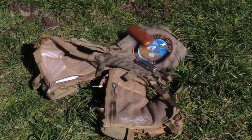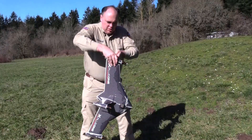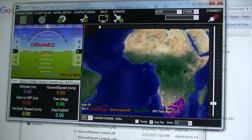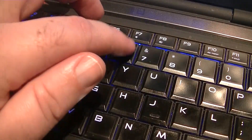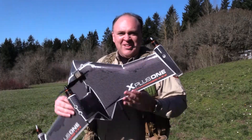In this part of the video, I'd normally tell you that before we can go flying, we have to calibrate the compass — make a big show throwing down my vest, removing metal objects, and twirling the aircraft around. Instead, you have to download the ground control software specified in the user's guide, connect the telemetry unit to your computer using a USB cable, power up the aircraft, specify the COM port and set the connection speed, provide the orientation value for the compass, and then follow the on-screen prompts. So that's a little different than we're used to. Anyway, let's get the aircraft ready to fly.